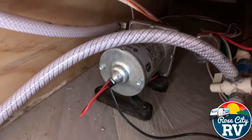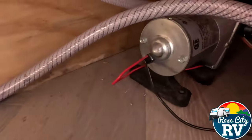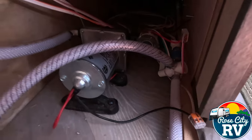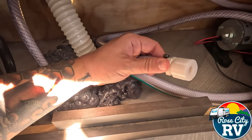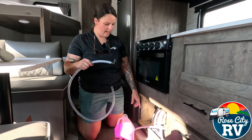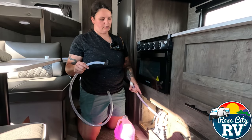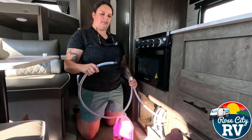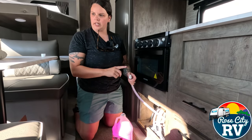What I'm going to do is check to see if this has a winterization valve — and this one does. That's this little handy hose right here, and it goes right to this valve. All we have to do is turn that valve and it'll direct the water pump from drawing out of the fresh water tank, and it will now draw out of here — which is where we drop this hose into the antifreeze jug and it'll draw antifreeze through the entire coach. If you do not have that valve — on older units, chances are you won't — take the inlet side of the pump off where it draws from the fresh water tank, hook this hose directly up to that, then drop the other end into the jug. But this one has the diverter, so I just turned that valve and I'm going to drop this into the jug.